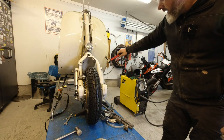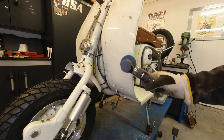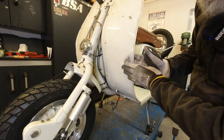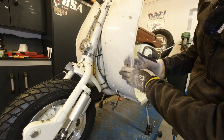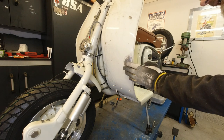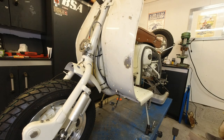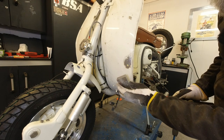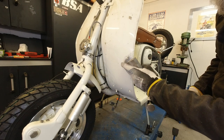I'll do the same on the other side. But first I'm going to have to remove the paint around here, and that means I have to turn on my noisy compressor. I sanded that down with my little mini sander. And when I run my fingers over here, I can feel there's actually a round indentation around that hole — so there's been some sort of bracket or something that's been put on there. That needs to be pushed out a little bit, and I think I can do that just by a little gentle tapping. What I'm listening for is the difference between when I tap it — you get the metal sound of the leg shield vibrating, and then you suddenly get like a thunk, and then you know that the metal has made contact with this bit of steel I've got.